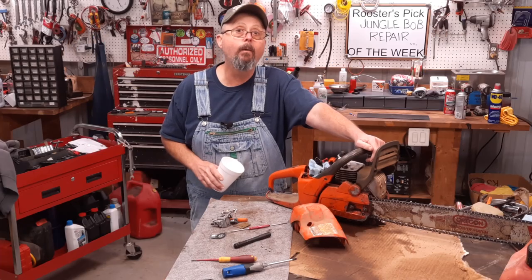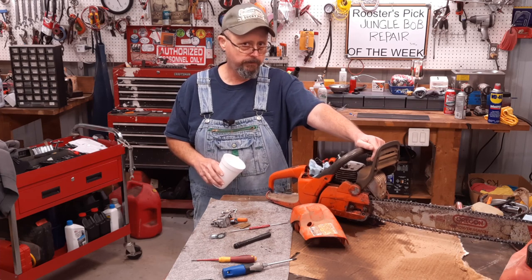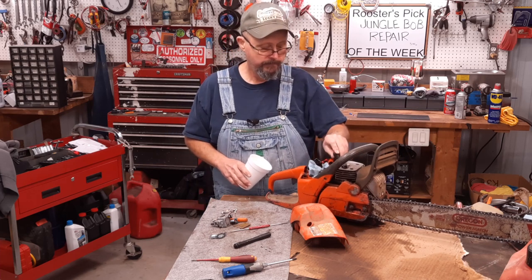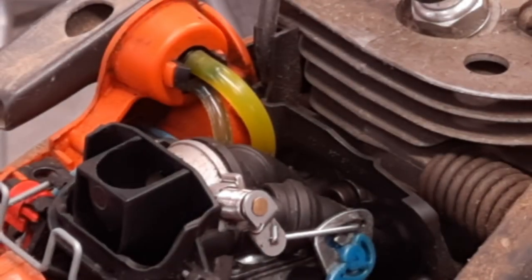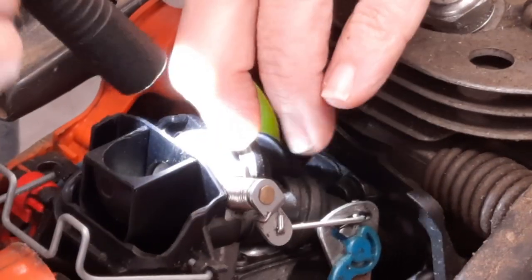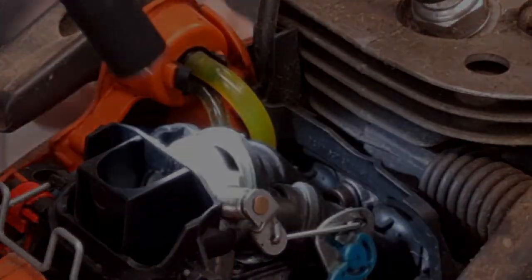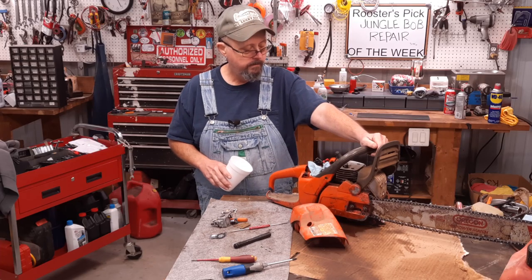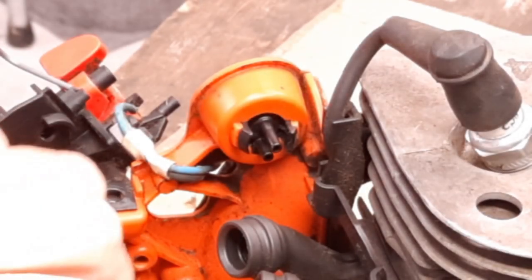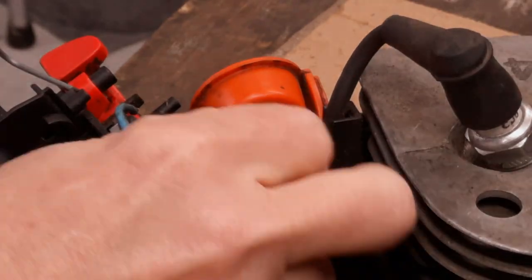The chainsaw is running wide open. I didn't crank it — I took the man's word on it. And as you can see, right here on top, it didn't even have screws in it. Got a big ol' air gap. So I decide, let's correct that. Then I get to looking and decide the fuel line on here is the wrong size — it's not even fitting well. Let's pull the carburetor off and do that.